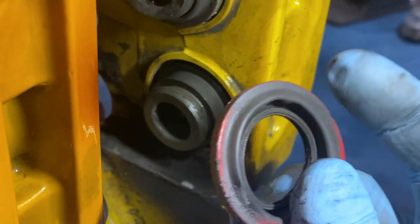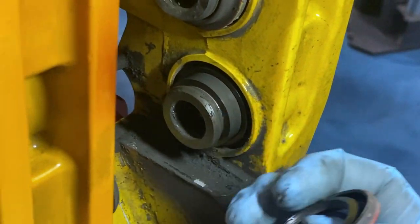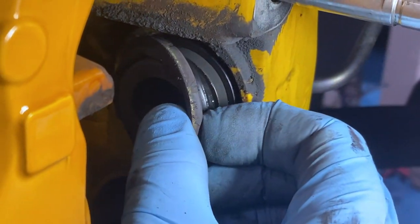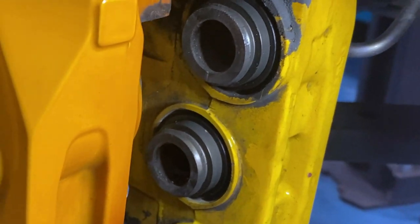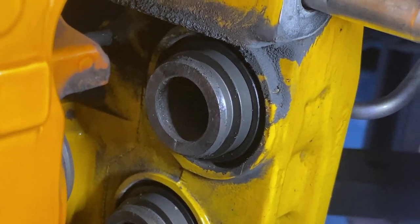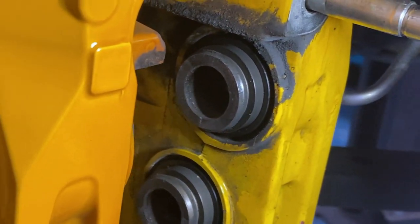There is a metal ring on the outside and the inside which fits in that channel, just rubber. The smallest one goes on the bottom. The middle and the top look like they're the same size, but the top one is actually just a hair bigger. That's the three from the inside. I'll clean those out — I'm going to spray some brake cleaner in around the edges, collect it in a bucket, and then install the new rings.